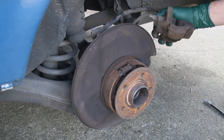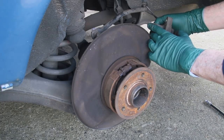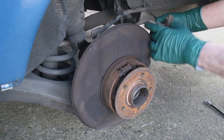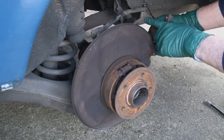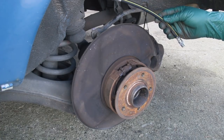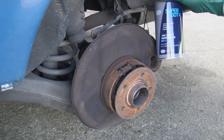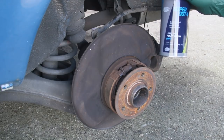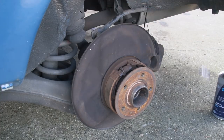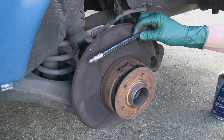The other thing I'm looking at is the flexible brake hose. These hardly ever get changed and they're so important for these old cars. As I've said before, these will get plugged up and not allow your brakes to work properly, or even overheat your brakes because they'll act like a check valve. This is such a common issue that I carry brand new flexible brake hoses in the shop, along with good high-quality DOT4 brake fluid with low moisture absorption. All four flexible brake hoses will get changed — they should be changed about every 15 to 18 years regardless of mileage.